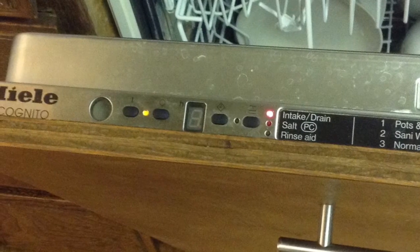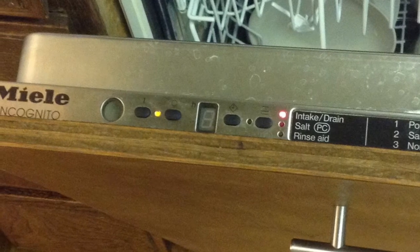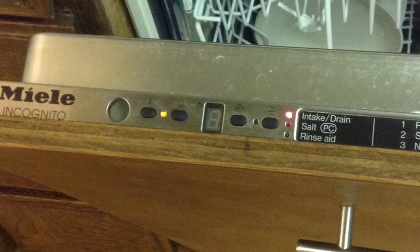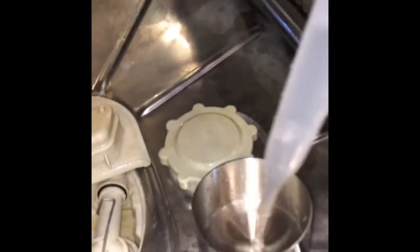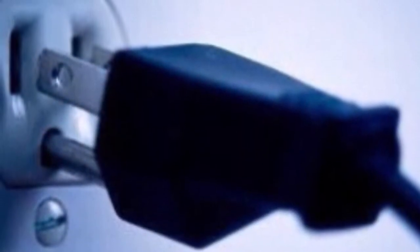Today we'll be looking at the Miele dishwasher, how to do some disassembly, part identification, and how to do some of the part removal. So first thing is we want to siphon out any water that's remaining in the sump so that we can tip it over, it won't spill. Got to make sure we either unplug it or turn off the breaker so there's no power.